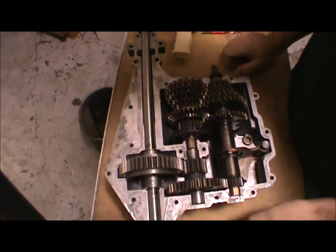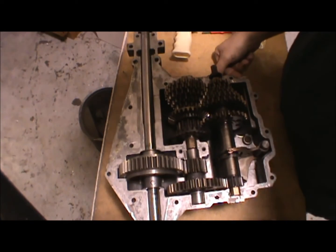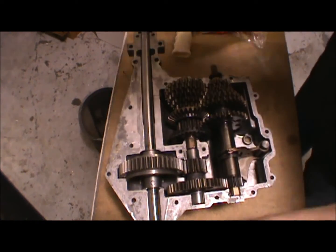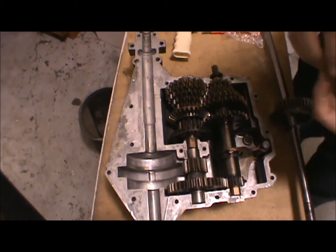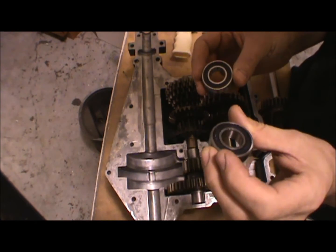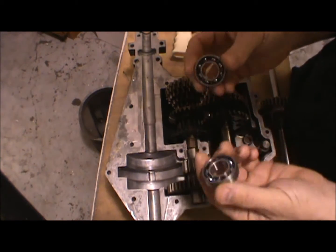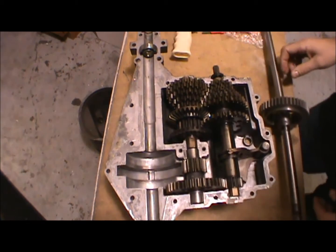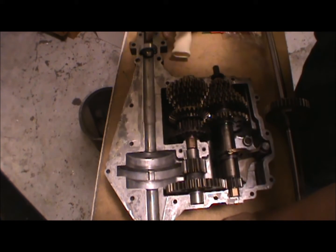This is the transmission ready to assemble. It has a spot here for bearings and I'm going to add them. This is a 6203 RS. I pulled the seal off of one side and put that facing inward, and that should help support the shaft.